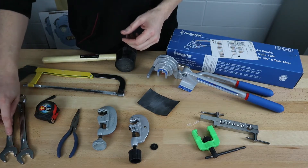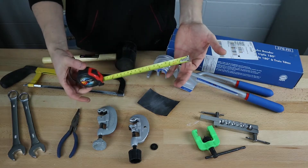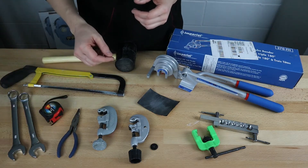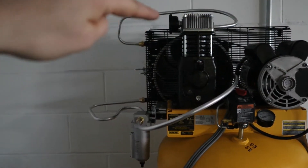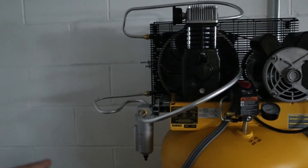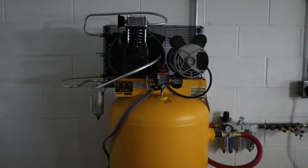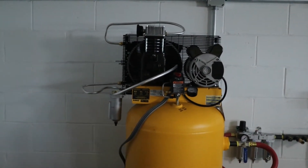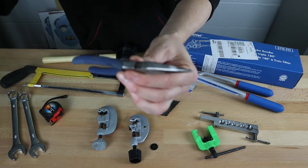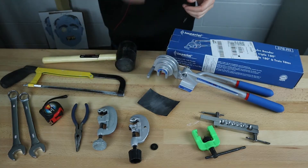A couple of wrenches — I needed a 13/16ths and a 7/8ths to be able to work the line, so good old crescent wrenches. Measuring tape — you don't necessarily need it, you can just wing it. But if you want neater results: the first line coming out of the compressor is roughly 33 inches long, the line coming out of the radiator going into the water trap is roughly 27 inches long, and the line going into the air compressor is roughly 35 inches long. Give it a little bit extra — you can always cut down. Needle nose pliers are used to start the flare on the pipes and clean out the edge and the burrs.